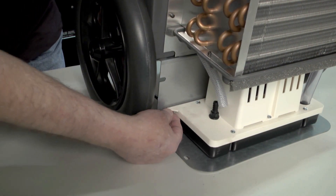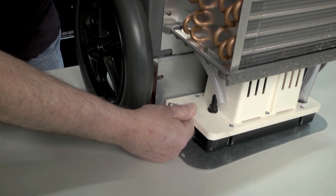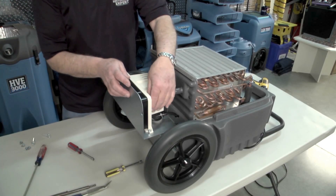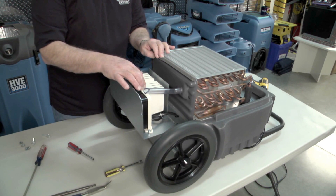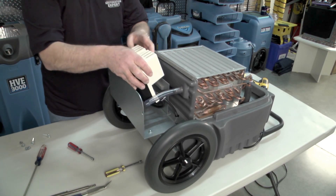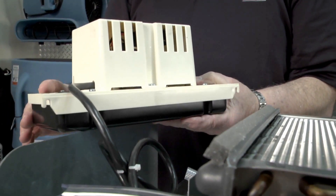If you need to remove the pump, there are two retaining bolts that hold it in place. There are ears on this pump so you don't have to fully remove the bolt — you just need to loosen it and it will lift up. There is one on the other side and you'll have to do both. Then we can remove the pump after we cut the wire tie. The next thing is to remove the clear inlet hose, which comes out of the drip tray and ends up in the pump. I then lift the pump up, clip the zip tie on the wire behind the pump to allow the wire to expand, and bring the pump up to disassemble it.